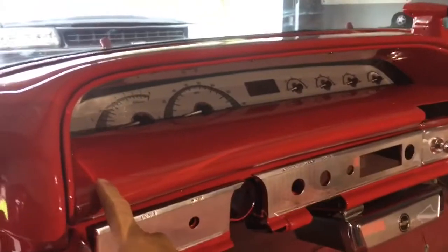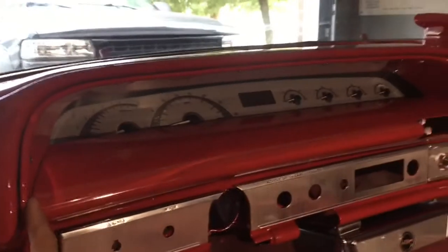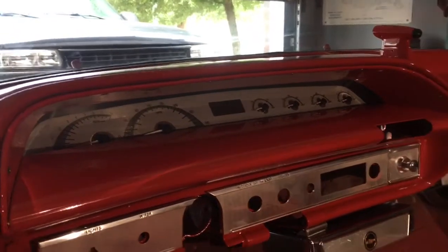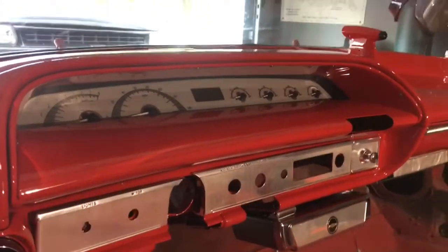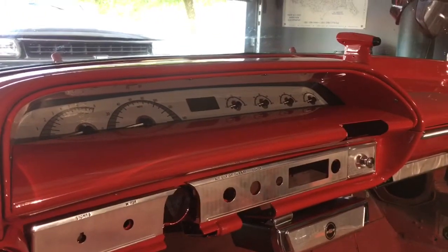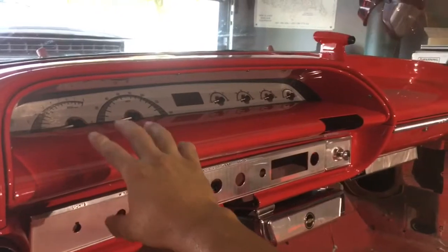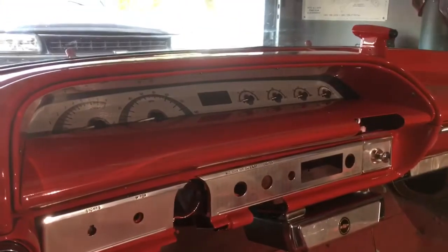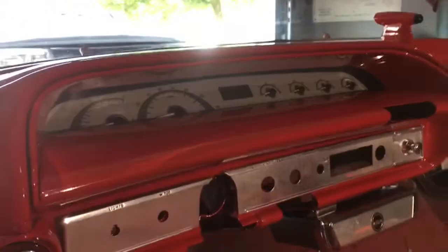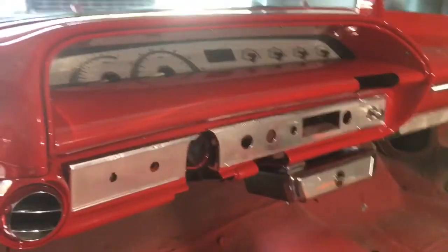Real nice piece. This bezel originally is welded as one piece, but it's technically two pieces. This little seam right here on both sides has a pinch weld through the inside, so you pretty much just drill out the pinch welds and you get it into two pieces. The reason I did that is because I painted it as one piece, and it was really awkward to paint. It's really hard to get the gun in there and clear the base, and it came out all right at first, but I just wasn't happy with it. Being that I had that dash already, it had to have something just as nice around it. So honestly, I ended up painting these things 3 times. 3rd time's a charm, and it came out nice after the 3rd time. I was actually able to cut and buff it, and it's super reflective, just like the outside. It's kind of hard to see here because I don't have the best lighting, but there it is.